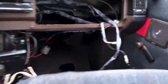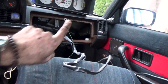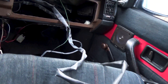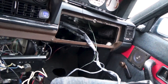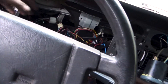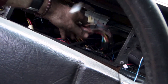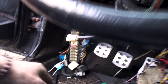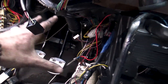I've got all the wires run. Some of them — like this big long wire — go all the way out through the firewall and all the way to the front of the car for the AC. All this goes out front; all this goes to the buttons and switches; these wires all go to the dashboard — the actual gauge cluster — and the light wires. The fuse panel has to get refilled and bolted back in, and all these wires need to be plugged in.